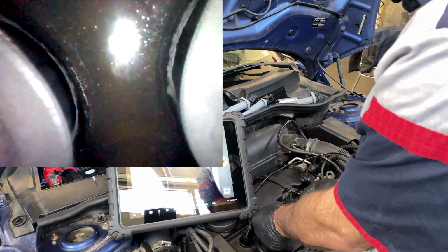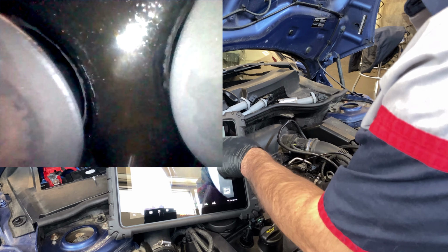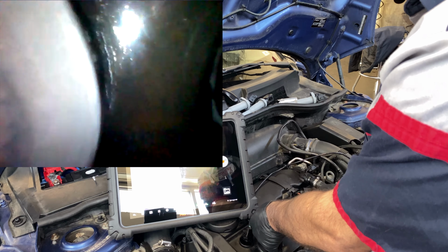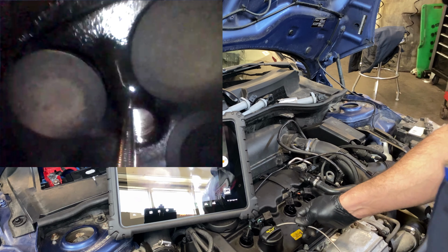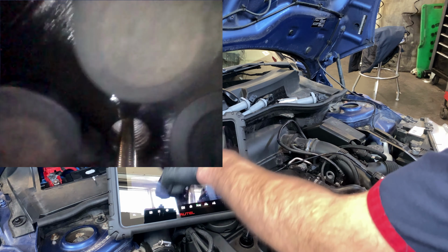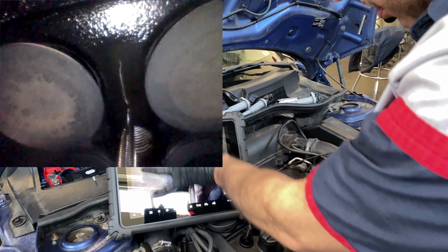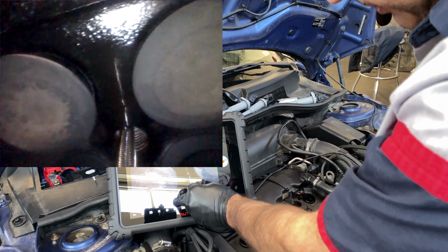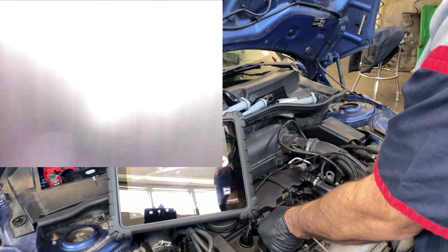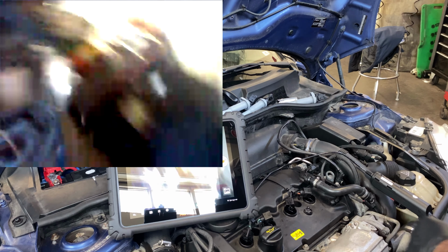And we can see that the exhaust face right here of the valve is still dry. I mean, it's seeping now there, but not because of the cylinder itself. But look at the valves. The color of the valve is even on both sides. You're definitely going to have a burning mark right where the spark plug is. I just don't like too much what I'm seeing on cylinder three. Let me clean the camera.